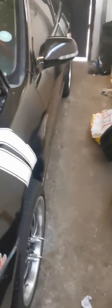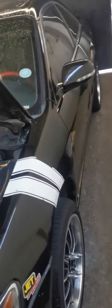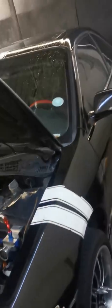I have a fuel pressure regulator. For y'all people just tuning in to the channel, this is an F23 A1 Accord. I have put a Walbro Hellcat 525 gas fuel pump back there. It was the maximum fuel pump out at the beginning of 2022, or 2021. Now we're in 22, so I don't know what they have now, but that's a Walbro Hellcat 525. It runs 60 PSI starting all the way up to 170 PSI maximum, which is what it pushes out for turbo car engines.